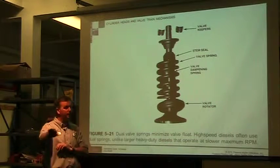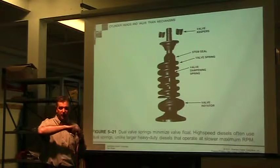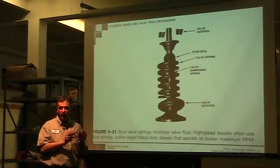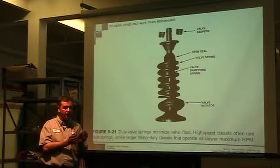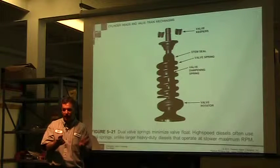Looking at the head on the table that we had, we were lapping it, and contact was on one side and not on the other. No heat will transfer on this side. All the heat would only transfer on the opposite side. That's a bad thing.